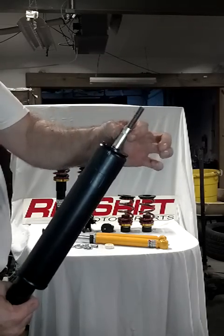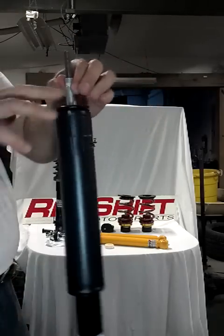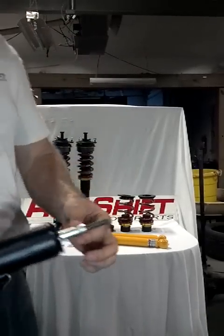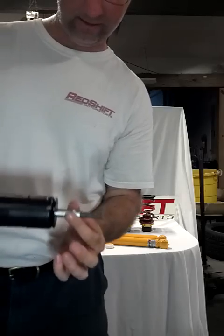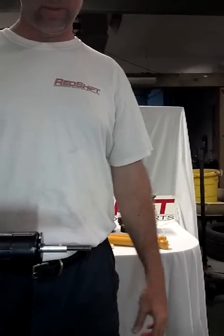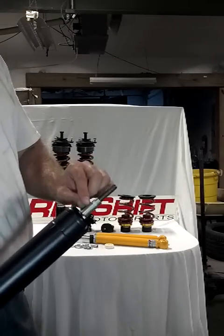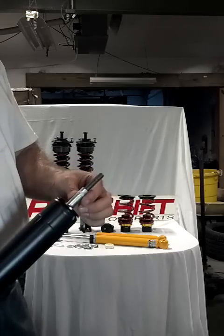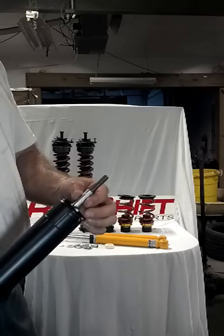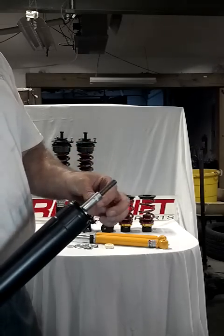When it's drilled out, you pick this up. You can see there's a little bit of space there, and you can usually fit a box wrench or something under there and pry upward — boom, this comes right off. The way I do it is I put it in a vise, clamp it, drill the top out, and then hit it with a hammer. This takes me about 30 seconds. Be careful because this is hard steel — if you try to go too fast you'll dull your bit. Go slowly, use some oil, try not to make too much smoke, because smoke means heat and heat is your enemy when going through steel.